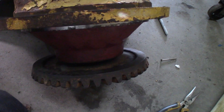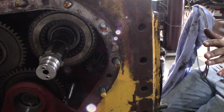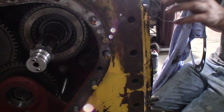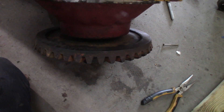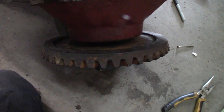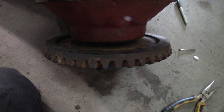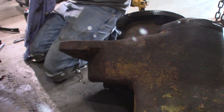We're gonna get a little bit of setup grease and cross our fingers. We're putting all the same shims back in because it's the same pinion gear, the same transmission housing, and the same final drive. But the ring gear — bevel gear — is not the same, so that could be a variance. You're supposed to put the bevel and pinion in as a match set. That's just shaft placement; that just moves the shaft back and forth. That wouldn't matter at all.